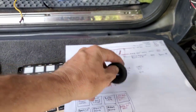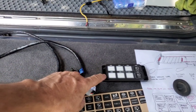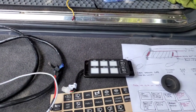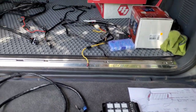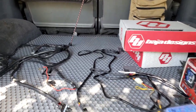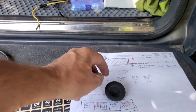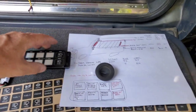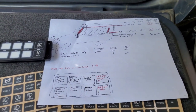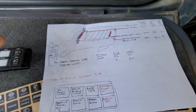Here's my little grommet in the firewall. It's going to have just one wire going through to the switches, along with all my other wires. I would have had to drill another hole in my firewall for eight different wires with the old setup. Here's my little plan — I'd suggest drawing it out, a simple sketch of your truck showing where you're putting your lights.